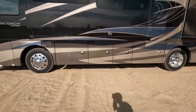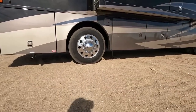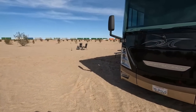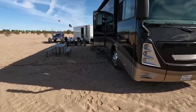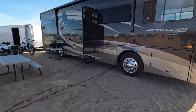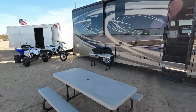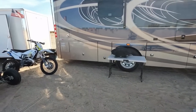Air suspension — this is on airbags at all four corners, but with a bonus: it still has hydraulic levelers. Air suspension makes the ride ten times better, way more stiff in a good way, absorbs things a lot better than just shocks and springs. Why I say the hydraulic levelers are a plus is because if you get stuck or have a tire issue, you can drop the hydraulic jack and lift the coach straight off the ground. So I like that this has airbag suspension but hydraulic levelers.